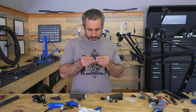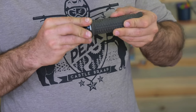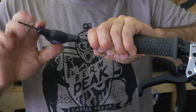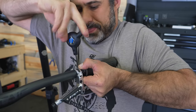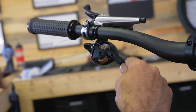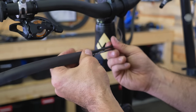Let's see how they work — much better. It's good that the company's listening and making improvements. That was way easier. Another thing I learned from talking to the rev grips guys is that you can over-tighten them and it doesn't change the way the grips perform. So I'm going to tighten these on really good. Then I'm going to undo the shifter cable and put the brake hose and shifter cable into heat shrink tubing.